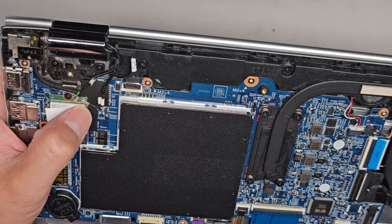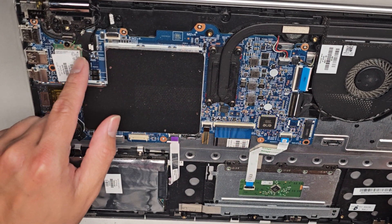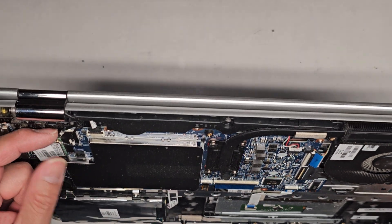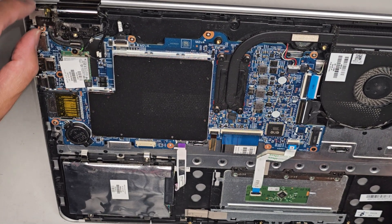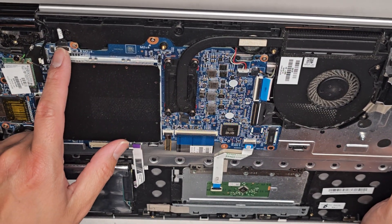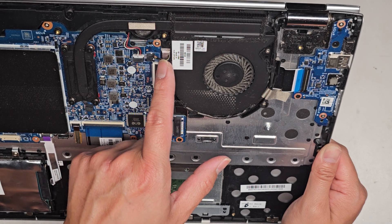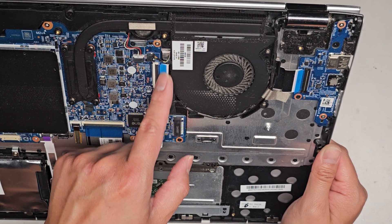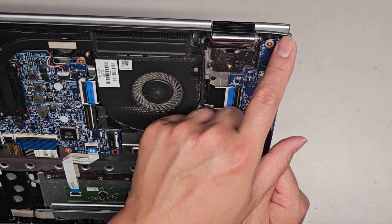You've got the wireless card here with both antennas. These are labeled M for main and A for auxiliary. To remove the antennas, go from the tail and pull straight up — I don't want to mess with the connectors as sometimes the solder isn't great. There's the DC jack charge port connector underneath the hinge. To remove that, undo the hinge screws, lift the hinge slightly, and pull straight up. There's also a speaker connection, a fan connector, and a thick flex cable that connects the USB port, headphone jack, volume buttons, and power button.